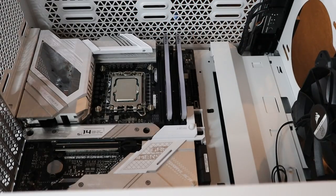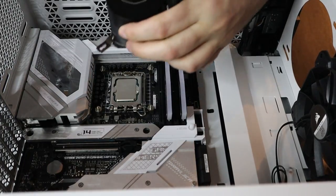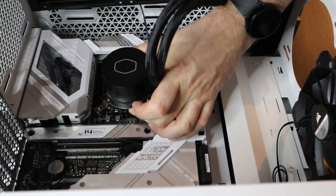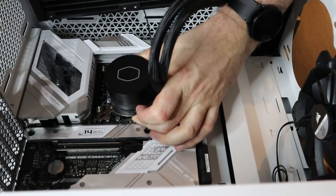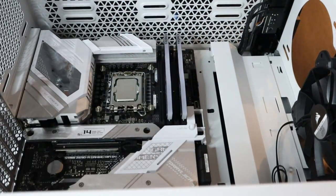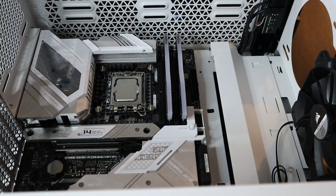It's in here. I was playing with the orientation of the cooler some, and the cooler I think I'm gonna put on last. One of the reasons is, I settled on an orientation, it's gonna be somewhat like this, where this is gonna be at the top. It's not necessarily the most aesthetically pleasing with the way the hoses come down, but it fits in there, it gives it a proper loop with no air getting caught in there. And that's what's gonna be important.